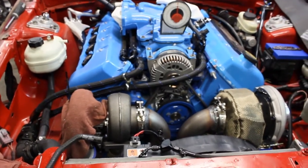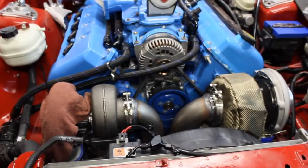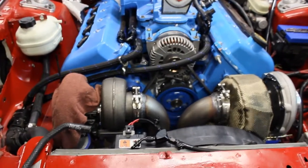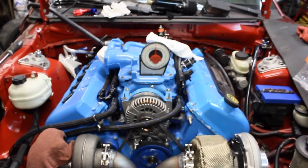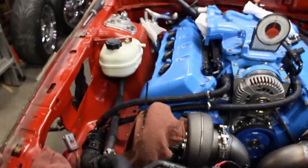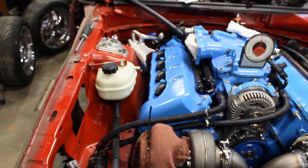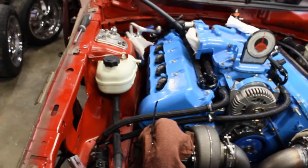The first of the month here — I've already got the wiring harnesses for the Megasquirt 3 with the expansion card on it, so I can run this full sequential fuel and ignition. We've got the harnesses but we're getting the computer first of the month, and we'll get that all wired in.